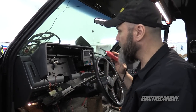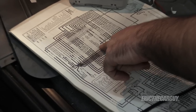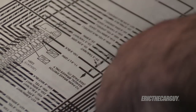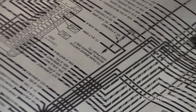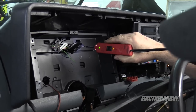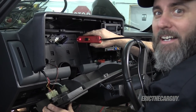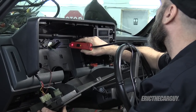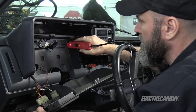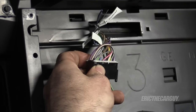And we need the all-important illumination circuit, which was right next door to the ground. It says here a tan-white wire is coming from the headlights. So I'm going to say it's a tan-white — right there. Turn on the headlights and dimmer switch — there it is. I had to turn the dimmer switch on. And sure enough, it's a little gray wire.